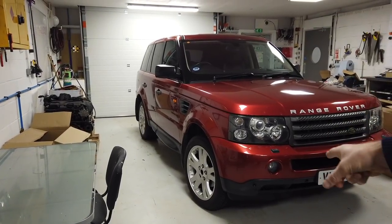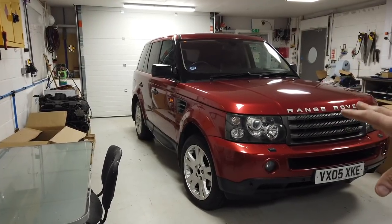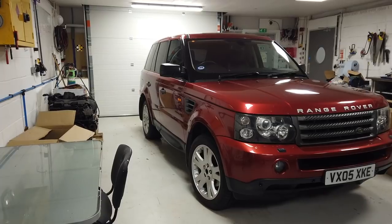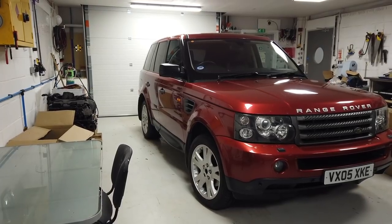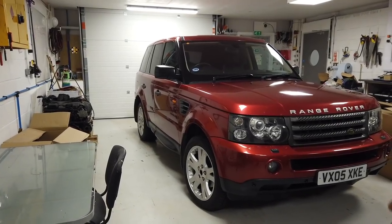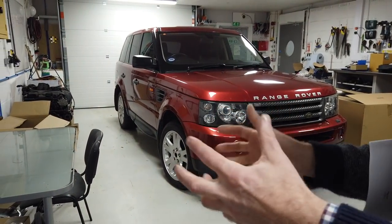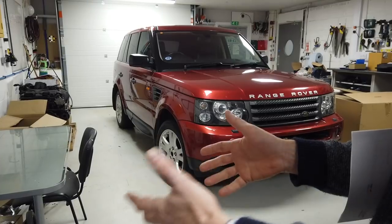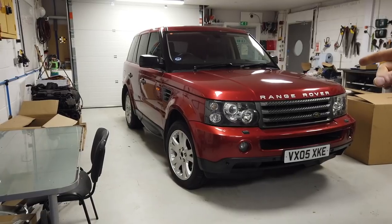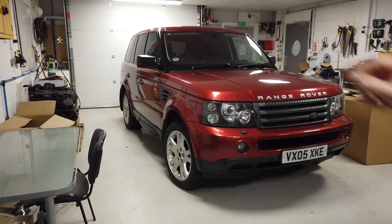We'll start on the front wheel - take it off, have a look, and pop in with the video camera. What we've got to do is take the wheel off, take the brakes off, and then we can clean it up or change the caliper. We can also have a go at removing the front hub. The hub and the whole hub assembly come off with four bolts and the ABS sensor. In theory it sounds easy. We'll focus this video on stripping down this front wheel and seeing what's going on.